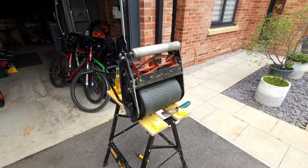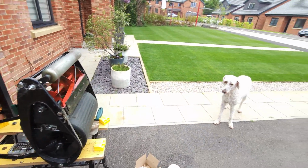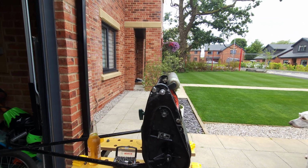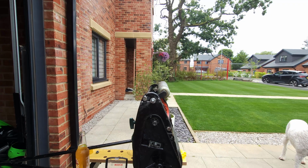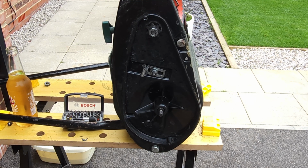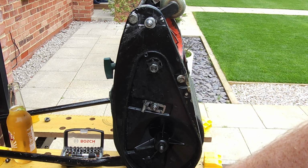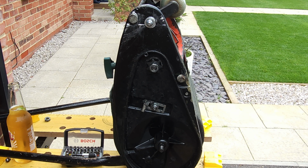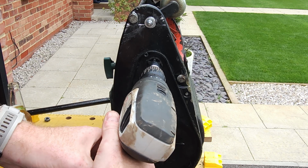But anyway, what we've got here, turn it round. So we've been making it nice and sharp on here, so I'll give you a quick rundown because I've tried to film stuff in the past and it's just been absolutely nightmarish. So we'll put this here and I'll give you a quick rundown of what we want to do with one of these. We'll zoom in a little bit. Right, so I've obviously took the side off with a Phillips head screwdriver. I've used a 17mm socket to remove the chain and the big cog. The drive on the little cog with a 17mm bit, reverse drive, and let's get you around the front.